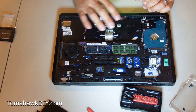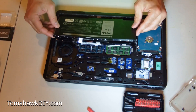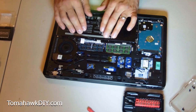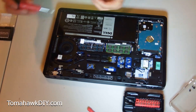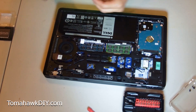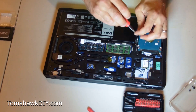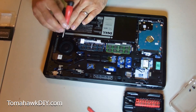Once that's done, put your battery back and close up the cover. Remember how this thing came out — it's got a side that slides under. Watch your cords. Click your clips back in place like so. We've got two screws. Be sure it's flush all the way around — right here it kind of stuck up on mine when I first put it in, and that'll cause you problems if you try to put the cover back on. Put my screws back in, get this one, tighten it down good and firm. Tightening this one down all the way.